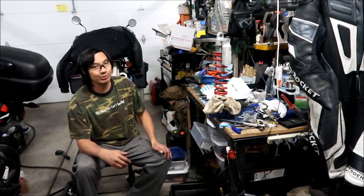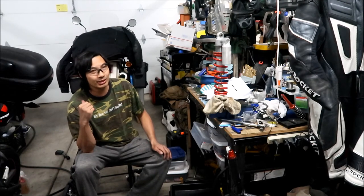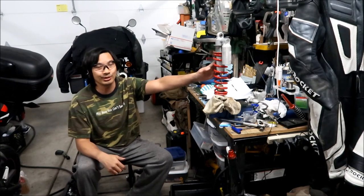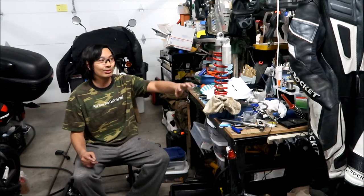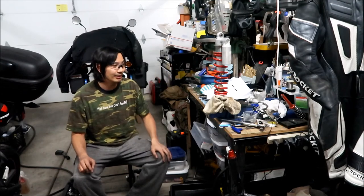So tomorrow, in the next video, we will be modifying the bike. We're going to flip the linkage is what we're going to do, and then we're going to modify the bike so this shock fits on it fine. So yeah, it's done. I'll just have to clean all the oil off of it, and then put nitrogen in it, and we're done